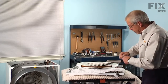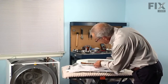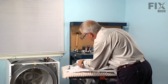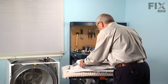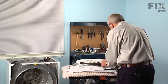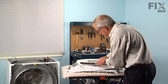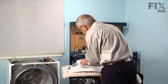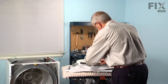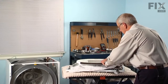We'll let that set up for a minute or two until it gets good and tacky before we apply the felt. Once the adhesive has become tacky, we can apply the felt. Start at one end, put it up against the lower felt, keeping it close to the rolled edge, tuck it into place, and then just press it in firmly. Ensure that the felt absorbs that adhesive and gets a good bond.